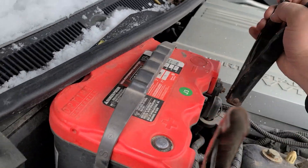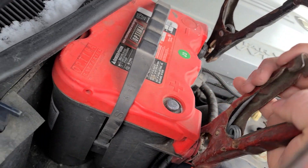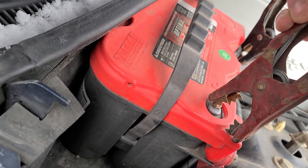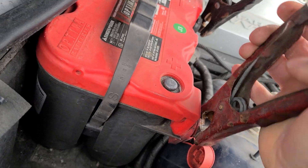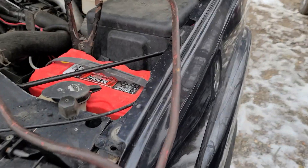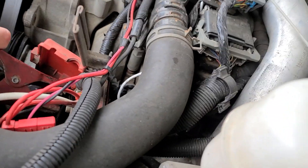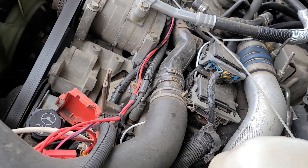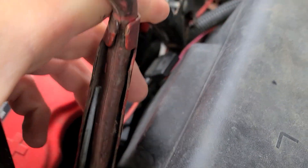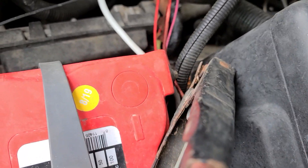Just cause I'm out in the cold, that's why. Wish I could get on those terminals. That ain't making a difference - that ain't doing nothing. Battery ain't that bad. Those cable ends are just frustrating. This is why side-post batteries will suck, but normally I don't have an issue. Normally I'm able to make do, and this is not making good at all. I would go buy a jump box, but I have not found one that's reliable and has enough juice to start a diesel.